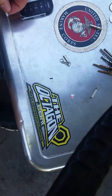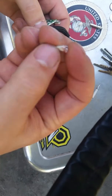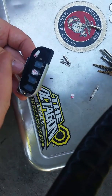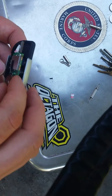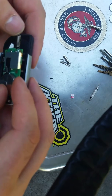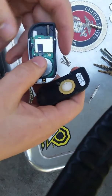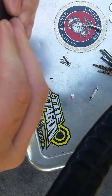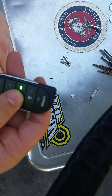Sorry, the camera's going to be sideways — tilt your head. What I decided to do is take that same packaging material and slide it in there just a little bit, so it presses the motherboard up against the back plate just a little bit harder and takes up that free play. You want to make sure it's just right so the case still closes but it's pressing up just a little more.